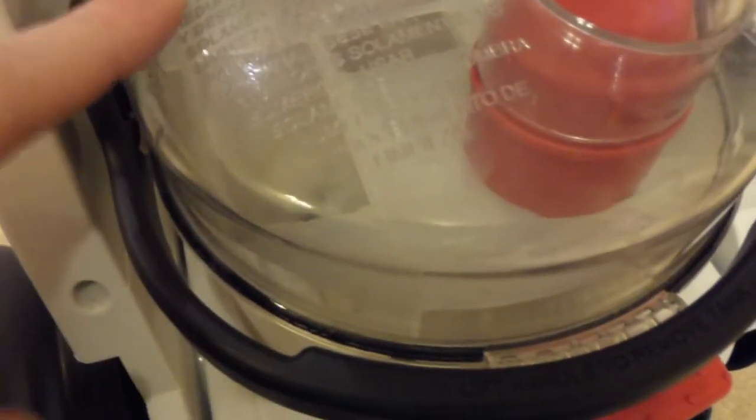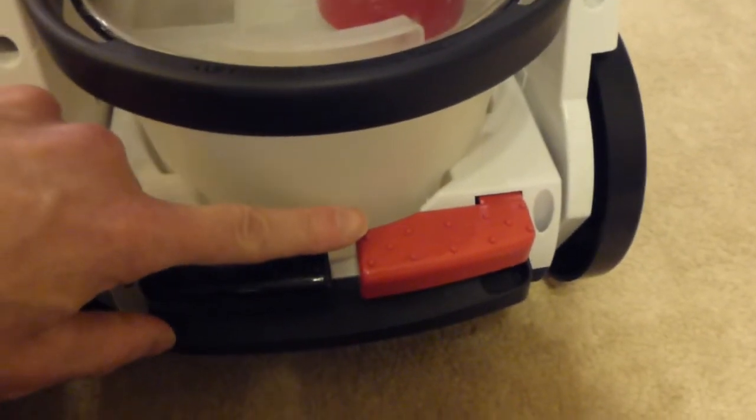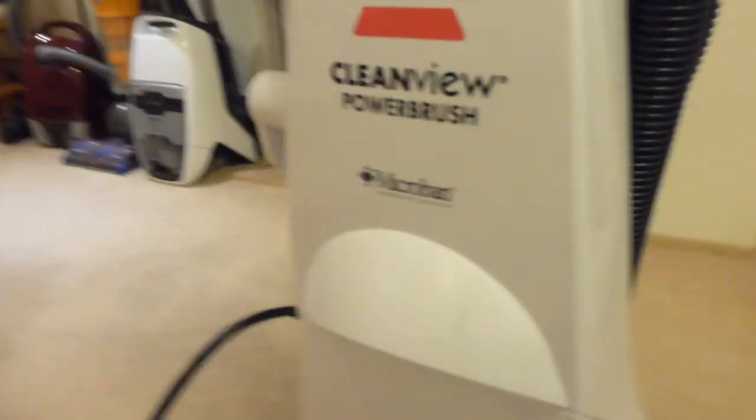We've talked about the solution and the tank-in-tank system. It's not very easy to see how much solution is left inside that bladder as you're using it — that's one of the big problems with this machine: not knowing when the dirty water tank's full and the bladder is empty. You can't really see very much from the outside because it's an opaque tank. If you're tugging on the hose and pulling it backwards you can see how that pulls the rubber seal away, so you always need to be pulling the machine forwards or positioning it so you're not forever breaking that seal.